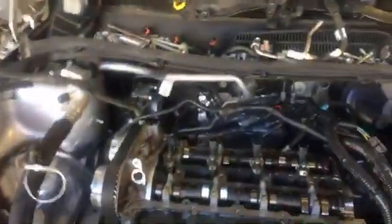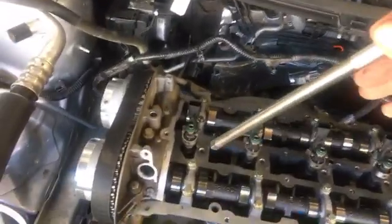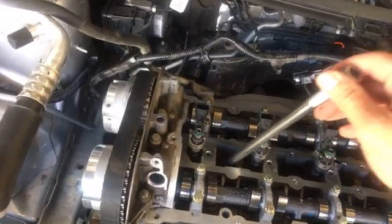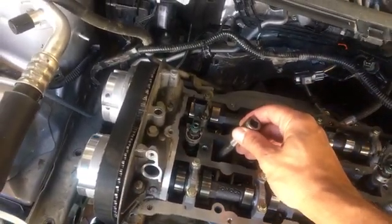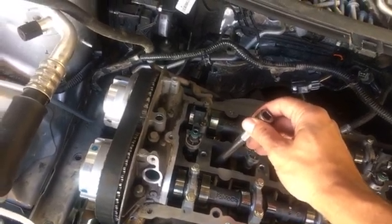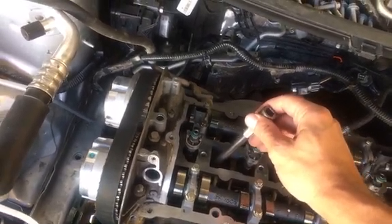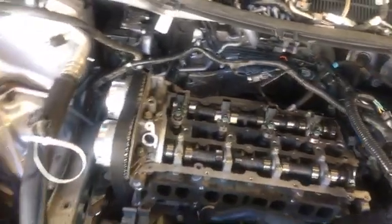We will turn it clockwise. I'll show you — I have a pin here for demonstration purposes to show how the piston goes up when we turn the engine clockwise. A little bit more... okay, this is it — this is top dead center. It doesn't go any further up; if you keep going it starts coming back down again.